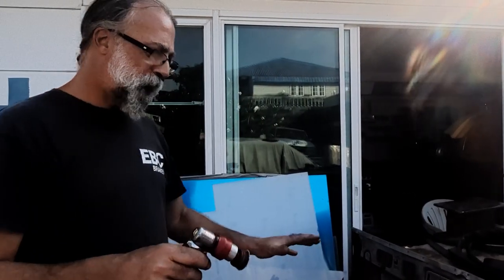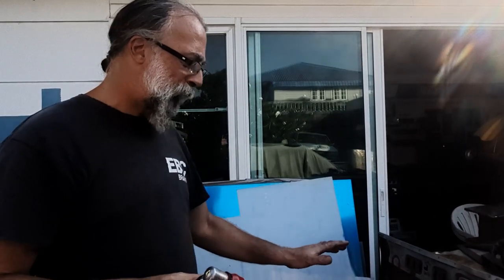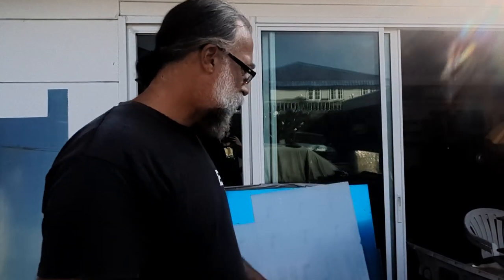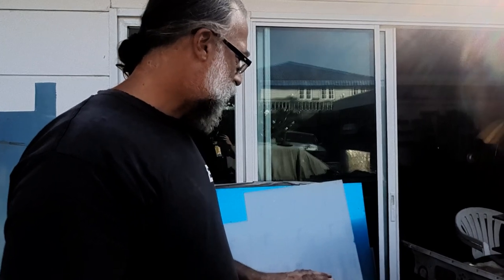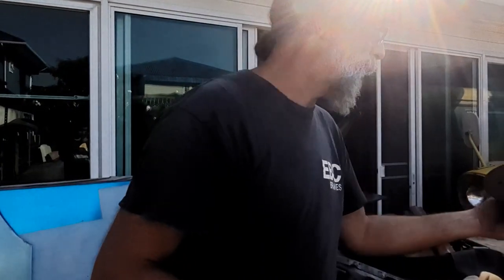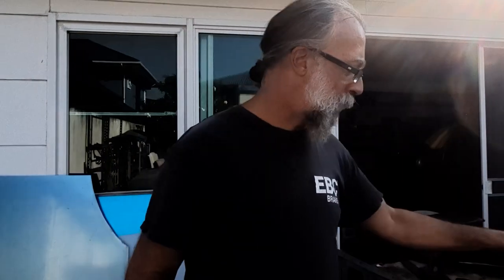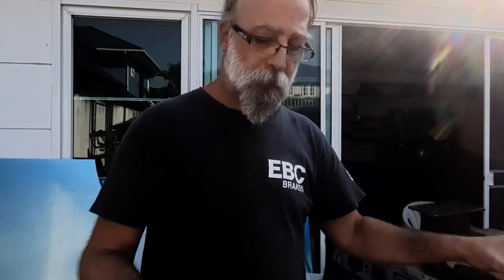Right, so just finished sort of trying to make the best of a can from the repair. And now I've got to strip all the paint off, get the rust converter on there, because I do that with any bare metal. And I'm getting into all the nooks and crannies. So we've got a normal DA here, which you use with 80 paper. But obviously you're limited with the size of that, and edges are an issue as well.